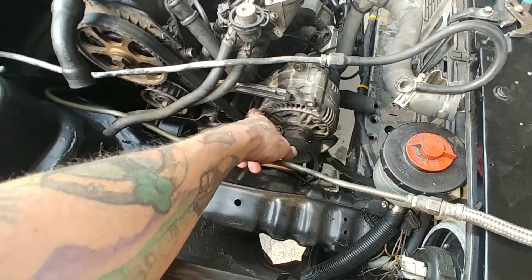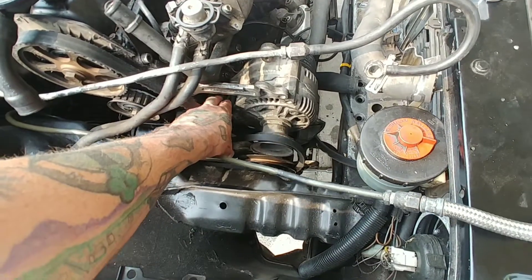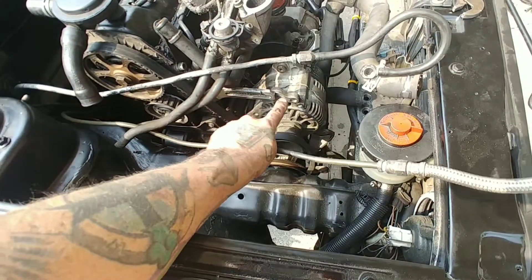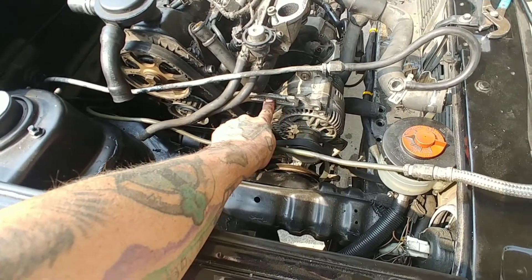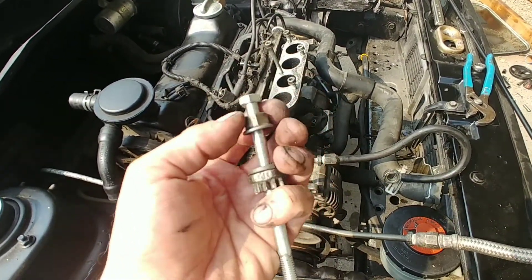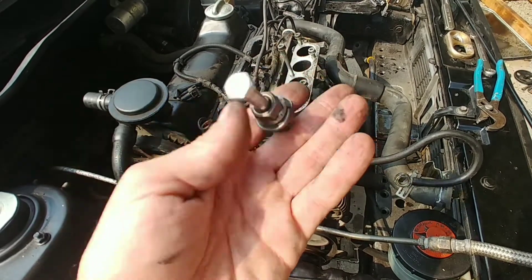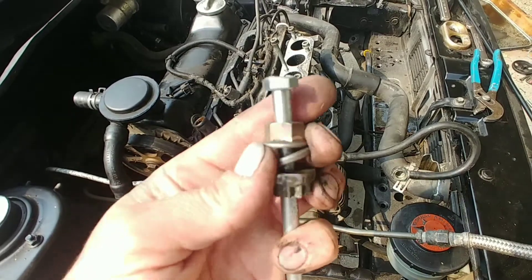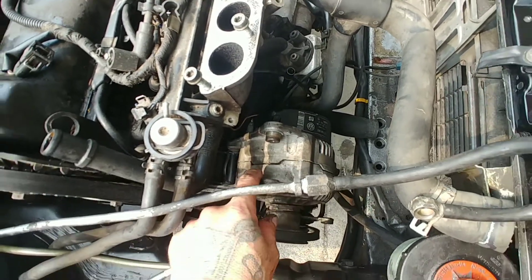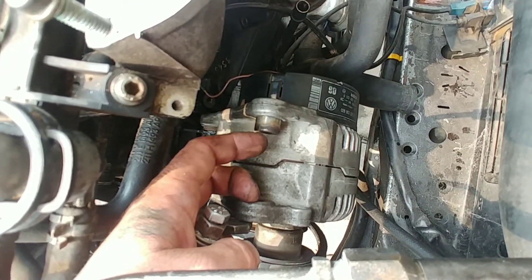My alternator — the last thing. I made this bracket which worked well on the other injection, but on this car it doesn't work. Tomorrow I'm going to take this out, these two posts are the right length so I'll use this bracket and make it longer, and with that length it'll kick this out so it interfaces with this, and I can use this bolt or this nut. This bolt is too long, I'll get a shorter one. Also, I was putting a bunch of these in trying to crush it together and it started pulling this bushing out of the backside, so when I put this together tomorrow I'll have to cut another sleeve and set it in there to keep it from walking out.